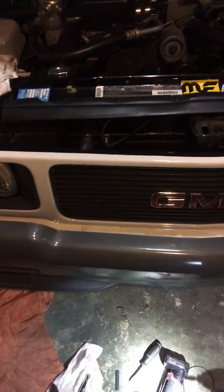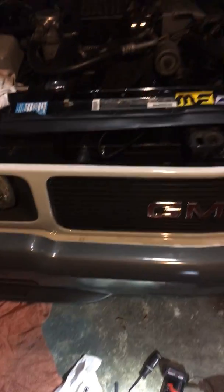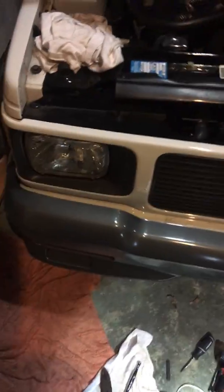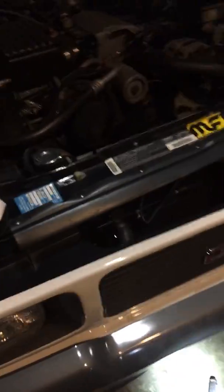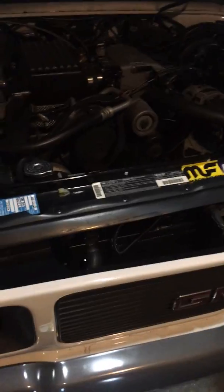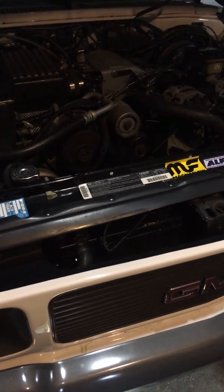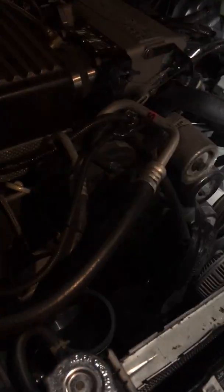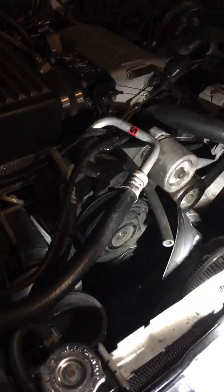Then I got to tune it. I got the Turbo Tweak chip for 60-pound injectors and methanol. I'm going to start with low boost, probably around 10, 15 pounds, and then maybe go as much as 18, 20 at the most, and that's it. And then the last step, at least under the hood, will be the Intrepid fans.